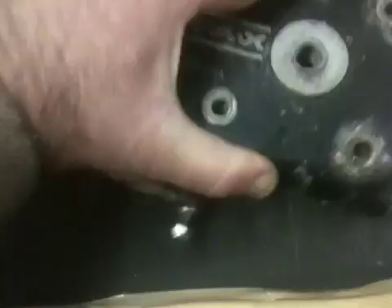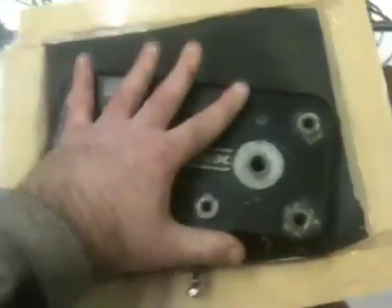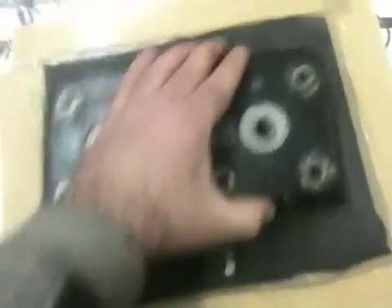If I go side to side on my flat surface — I'm just using a 120 grit — this is going to bring it down even. The idea is to go 45 degrees each way. This was shown to me by a motorbike fitter from years ago. Must be the old way of skimming a head.